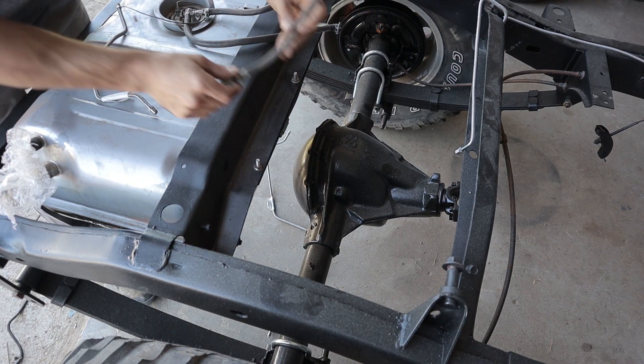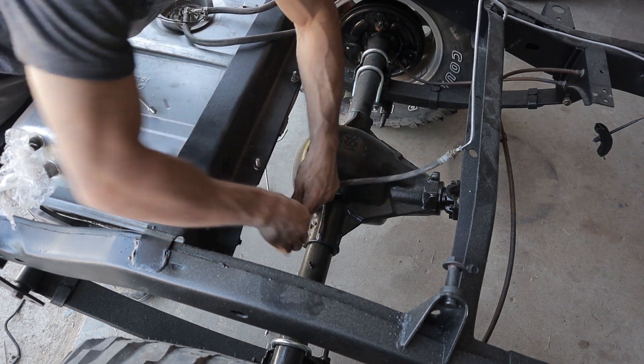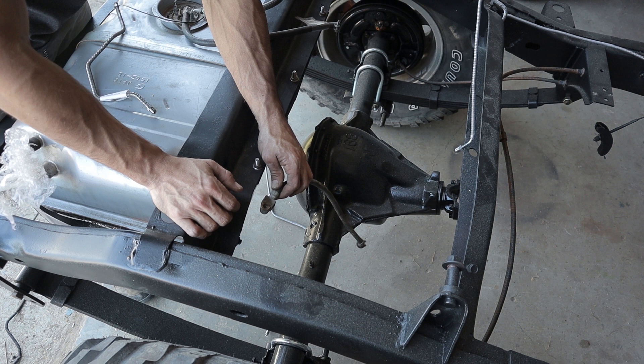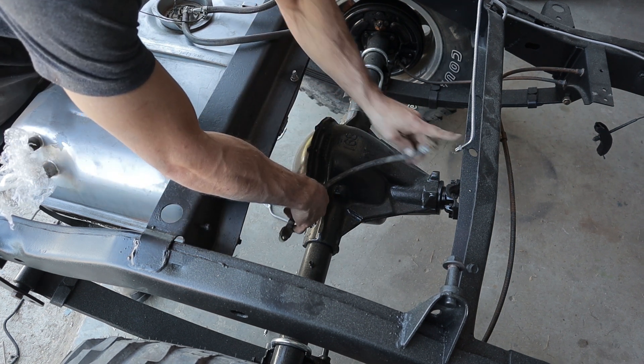The rear has a soft line that kind of goes into the frame and connects right here, connects to the brake line, and then connects to the axle tube, and then it splits with more hard line that goes to each wheel. So we're going to get this mounted and get it hooked to our hard line right here in the frame.